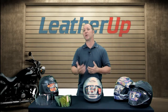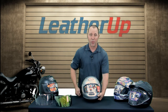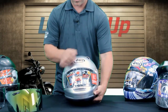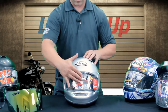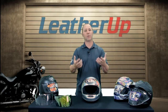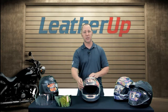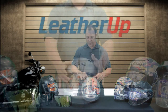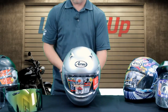Ventilation — we need to keep you cool inside that helmet, especially during the summer months. Arai has really addressed ventilation. Starting at the chin bar, there's a quick-open multi-stage vent that pulls a lot of air in directly into the chin port. Also unique to Arai helmets are these brow vents, which can be opened up and vent right to an interior vent above your brow. If you have a problem with fogging on shields, you can crack these open — that typically helps with fogging. Plus you have two top diffusers that pull air into the top of the helmet with a quick click, operable with gloves on.